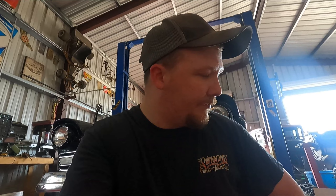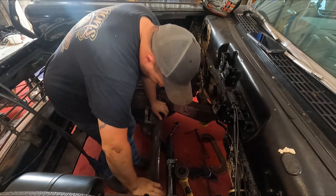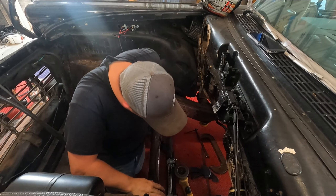The only bad thing is I already did some measuring — the tie rods are going to be at a kind of steep angle. The reason is this engine doesn't weigh a lot so the front end sits real high right now. I'm gonna have to put some Z-bar style tie rods or something in there, or I can do heim joints with misalignment ends. We'll see how it goes.